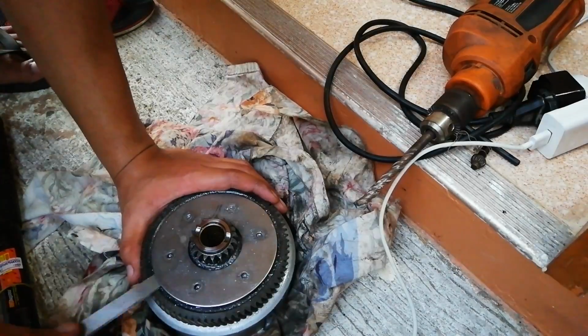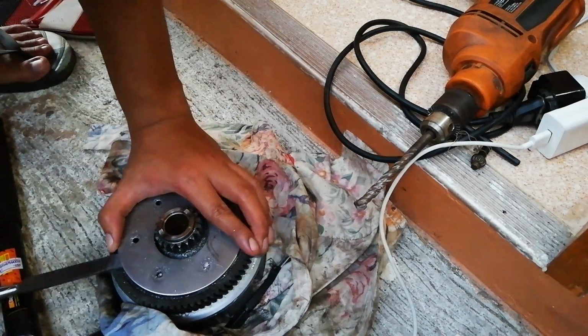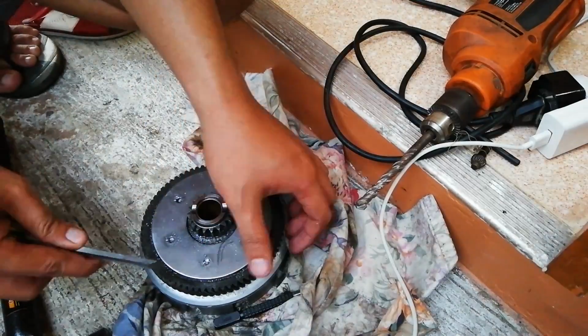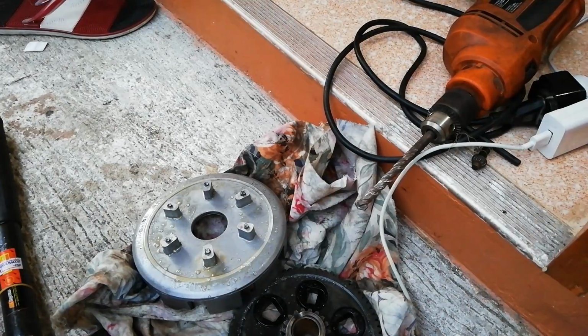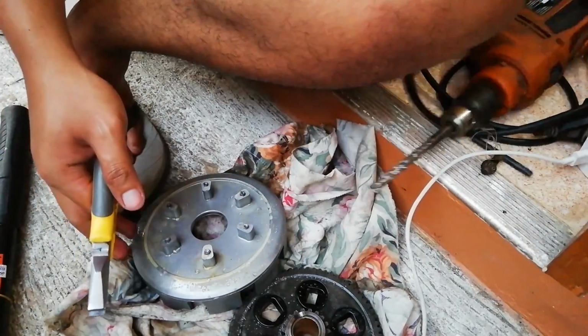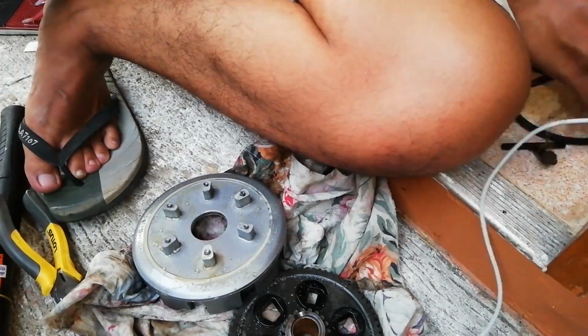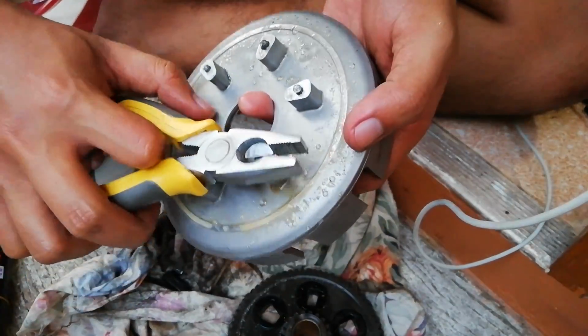Now you are curious, what went wrong? Well, the answer was very simple. Remember that initial drilling that we do using the tiniest bit? We need to drill almost all the way through the body of the rivets, surpassing this aluminum part. In that way, the rivets will not lock again, like its property as a rivet, when you hammer it down with a center punch.